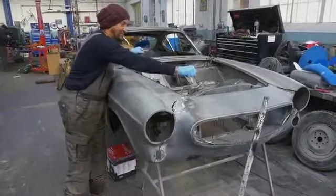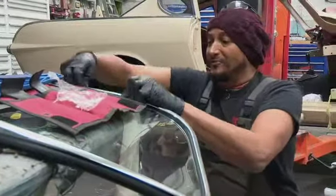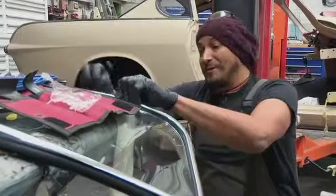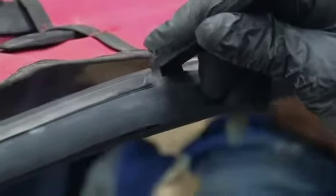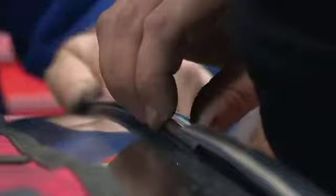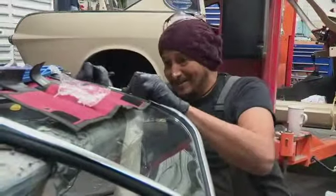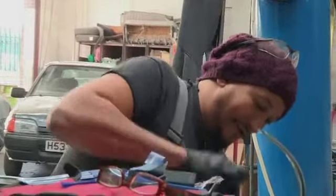Try and put the bonnet on and it doesn't fit in the hole. One of the fiddliest jobs on a classic car is fitting these little bits of chrome trim around windscreen rubbers. There's a little lip that it goes into - it has to hook underneath that, and that's all that retains this little chrome embellishment. It's not an easy job at all; it really makes your fingers ache. But I can't wait to see Peter's face at the MEC - that will make it all worthwhile.